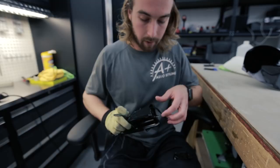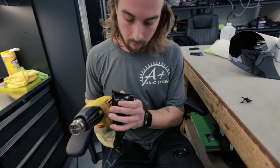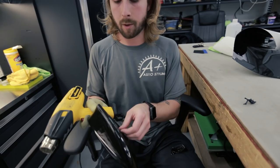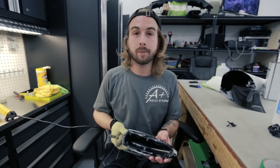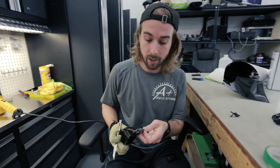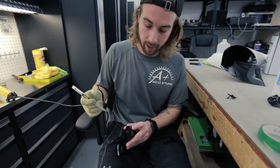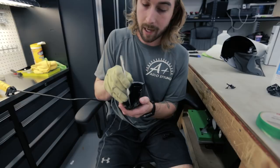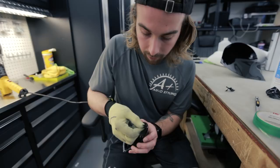Do the same for the other side. Now you can generally see we have almost the whole antenna done — we've got the back and sides. All that's left is the underside and the front edges. The front is really the only difficult part; it's a little round to just lay vinyl around and hope it sticks — you'll end up with a lot of excess and fingers. The best approach is to do a couple of pie cuts, fold it over cleanly, and stretch it underneath so the overlaps aren't visible. That gives you the best finish.